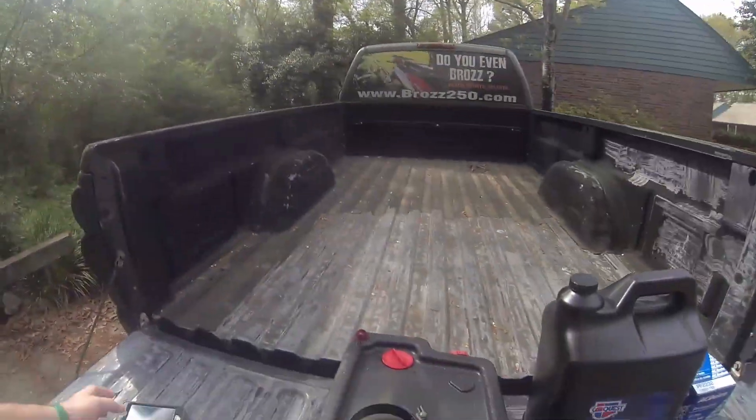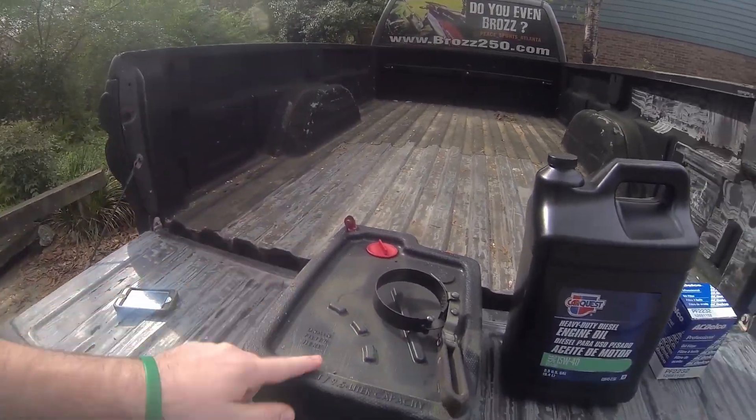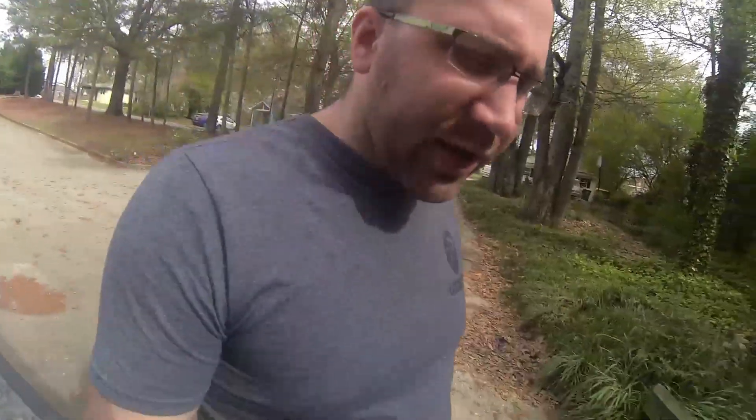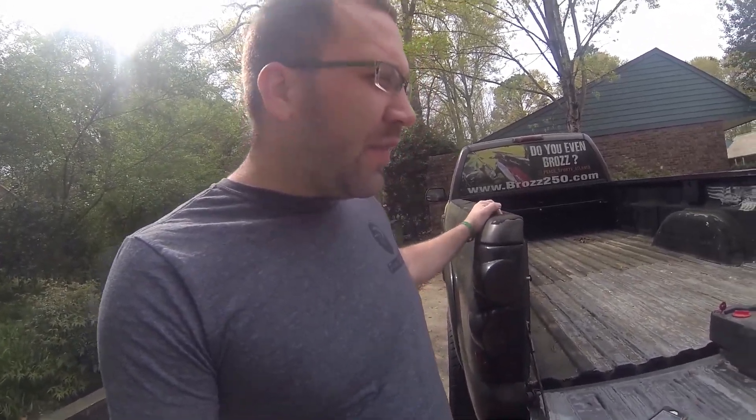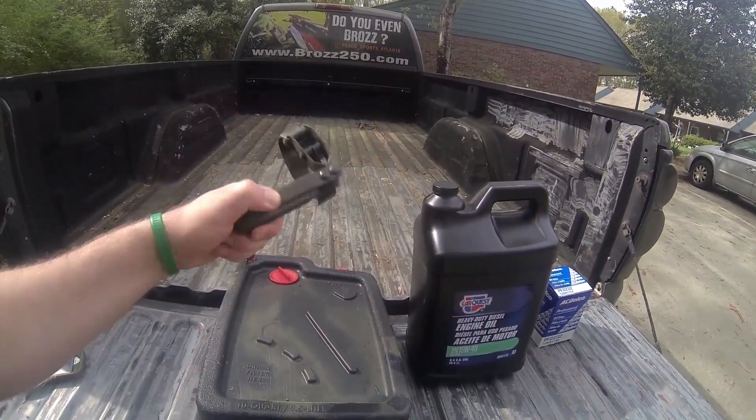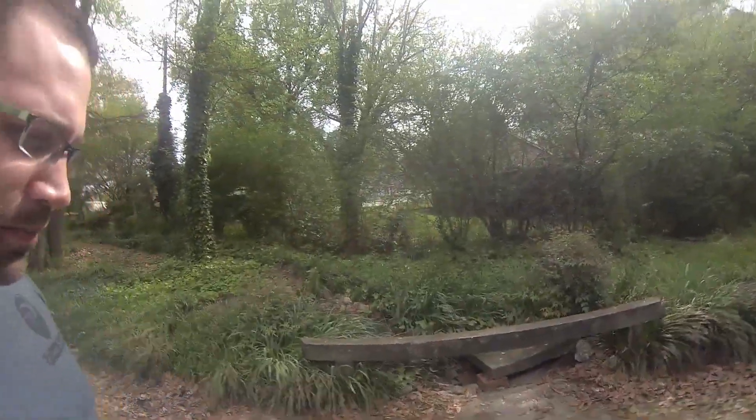When I went there, so that's what I'm going to run for this one. You'll need your oil filter wrench and something to catch your oil. As you can see, this is 10-quart capacity so in theory you should be pretty close to emptying it. I use the easy drain oil valve — I'll have a link for that in the description if you want one, but that is definitely something I would recommend. I put that in all my vehicles now, and that's why I don't need any real tools to do an oil change anymore. So let's get that started draining.